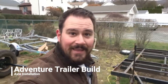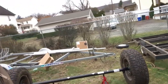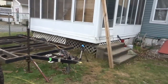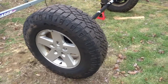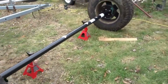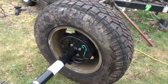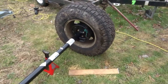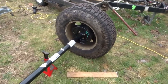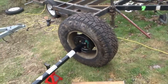What's up all, it's Carlos again. Today's project is to mount this axle to this trailer. I got a new 3500 pound axle, some brake drums, and some wheel adapters to run these Jeep wheels. Because it's 3500 pounds it's going to have tougher spindles than the ones that are on there, and that also allows me to run the brakes. With this much more rotating mass, the brakes are going to be worthwhile.